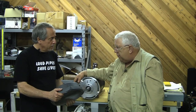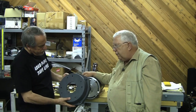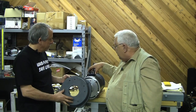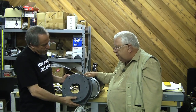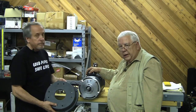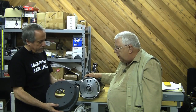We had your friends at Cape Precision Machine do some work. Here's the problem: this is a Warp 9 mounting plate for a VW transaxle — we got it at EV Source, it's from EV Canada. But the holes were in the wrong place. They fit fine on the motor, but our terminals were off on one side. So we rotated them about 15 degrees, from basically sitting in this plane over to like this. That positions our electrical contacts top dead center, plus or minus — out of the way of the battery boxes we're going to have on either side.